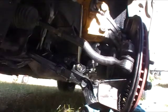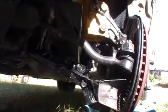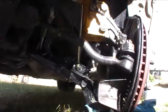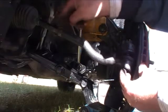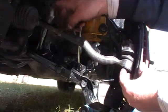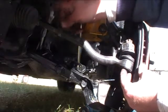Okay, now I'm going to change the tie rod. I've already prepped up a few things — put a new tie rod in there. I've already loosened off the ball joint and loosened the nut, and I've put a bit of electrical tape on the top there. You could use a texta or whatever, maybe a dab of grease or something, just to make sure that you've got the steering arm facing the same way when you take this control arm off.